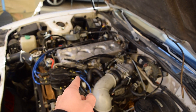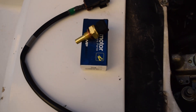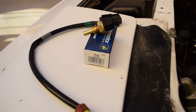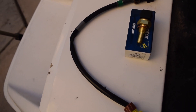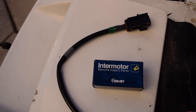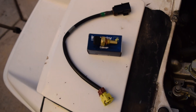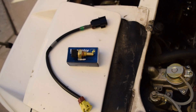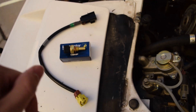So I'm moving it up to the top here. This sensor is from a 95 Pathfinder — I'll link to the Rock Auto page. The part number is TX18. I got this one from Rock Auto because I couldn't find the original Nissan part. If you have the part number for that, drop it down below and I'll put it in the description. This one is Intermotor genuine import parts, which I think is going to work fine. I also got this harness from NissanPartsDeal.com — it's about $20 plus $7 shipping. So altogether this is about a $40 to $50 upgrade depending on where you get your parts.